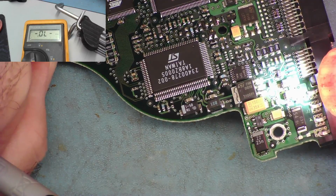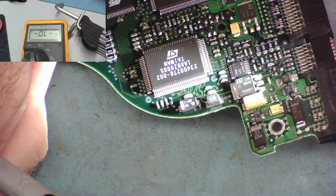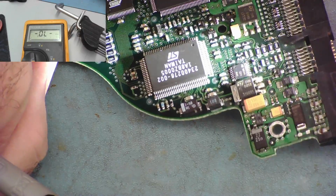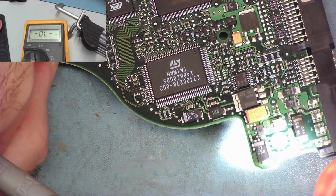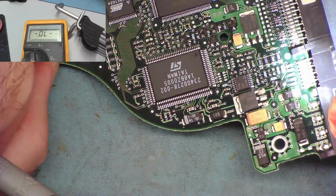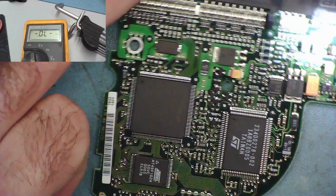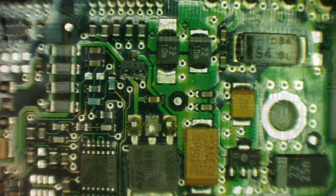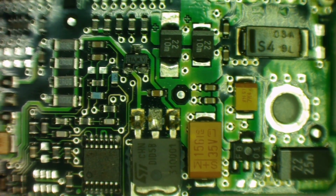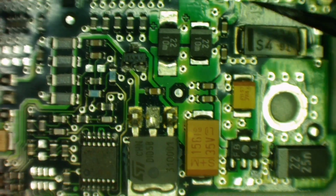It's there, so CHN DID5B. Is that a diode? And we can just look at this thing now, and those two pins that are reading short are not connected to each other, that's for sure. But they could be connected across those low value resistors and it would look like a short.